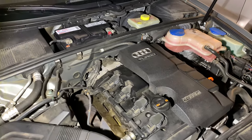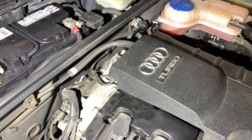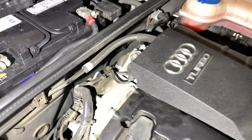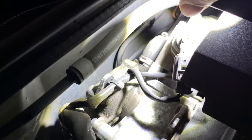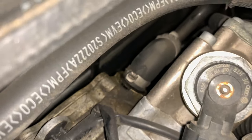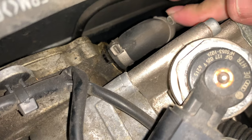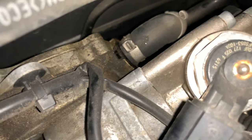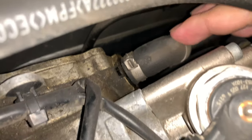I've got the motor running here and because I already kind of warmed up the car it's not as pronounced as it was when I first fired it up, but the issue back here is this vacuum pump. What might be really tough to see — I'll try to demonstrate — is this little elbow hose here tapping on the vacuum pump. There is a plastic nipple inserted in here with an o-ring to take up the slack and make it tight, and this elbow hose is basically a permanent piece of the vacuum pump.